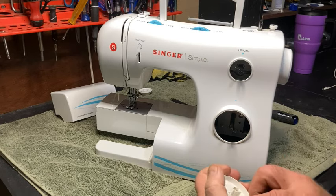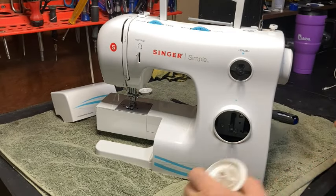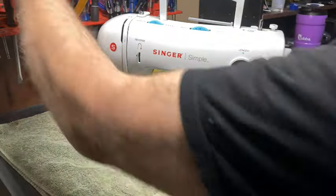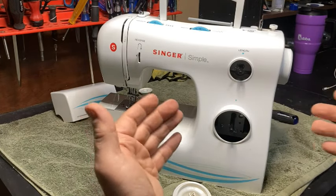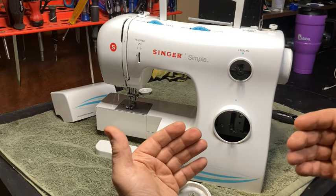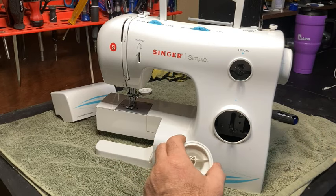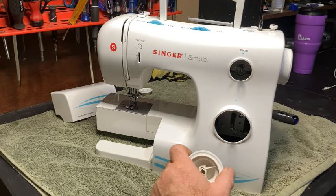Okay. And as well, you can tear this up as well. So you want to be real careful when you're doing that, because it don't take much to break this plastic. It'll break real easy. The reason for two screwdrivers, one on each side, whether it's top and bottom or left and right, whatever works better for you, is that it puts an even amount of pressure so that it's not putting the piece of plastic in a bad position. It's not pinching anything. It's pulling it straight off.